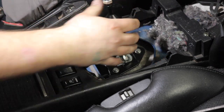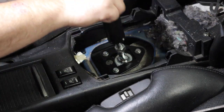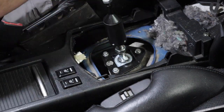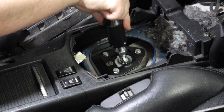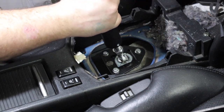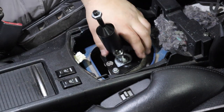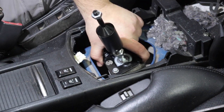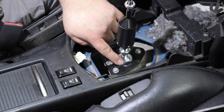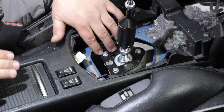Now we have it hooked up to the transmission. To get this adjusted as close as possible without driving, I'm going to put it in fifth and sixth gear. This shifter has the reverse lockout built in — right now with it adjusted improperly, you can go all the way over into reverse without any resistance. The reverse lockout should require you to push down and then over. So I'll find all the gears: first, second, third, fourth, and just barely over is fifth and sixth. Then I'll slide this reverse lockout over — but I don't want it touching. If it's touching you might have gear grinding issues, so bring it all the way over to where they touch and then space it back about a millimeter or two, and that's where we lock it down.